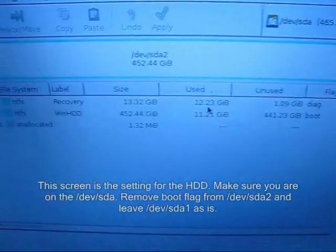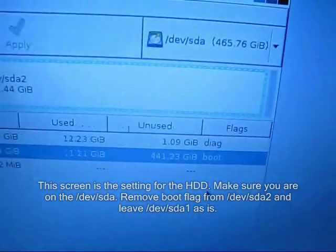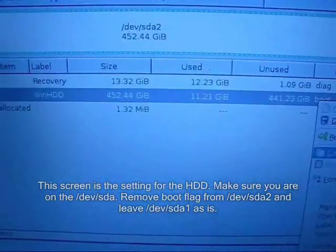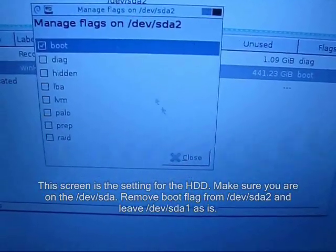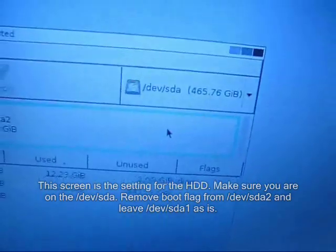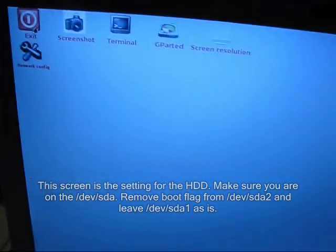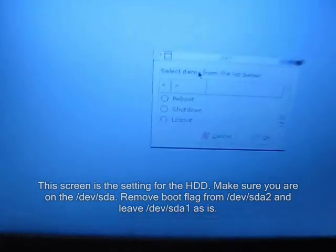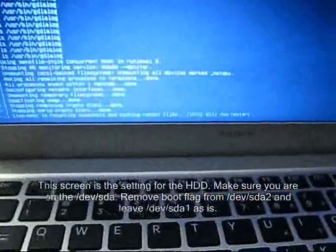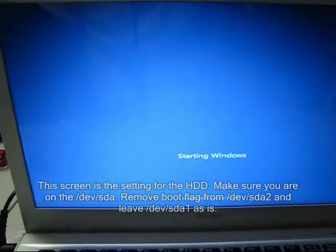This is the configuration you start out with when you first come into GParted. You look at your drive configuration — you have your recovery and your secondary hard drive. Come in here, click Manage Flags, undo the boot partition by unchecking it, and close it. Make sure you see no boot partition there. You don't have to apply anything — it does it automatically. Then close out, say reboot, and as soon as it resets, pull the USB out; otherwise it's going to boot from that and you'll be back to Windows again.